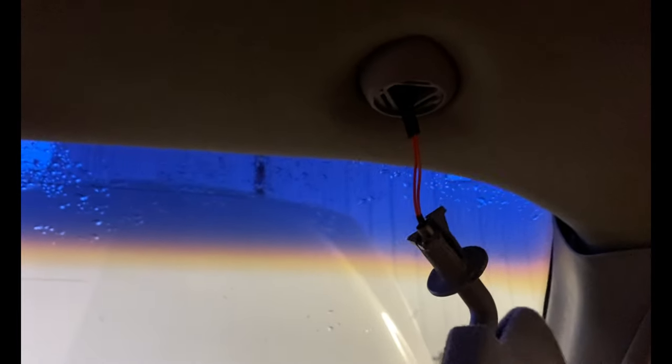You want to make sure your screwdriver is putting tension on both sides of that slot, because these two things are going to turn together — this piece and the piece on the sun visor. You're going to want to pull down until there's a space, then rotate towards the window and they'll fall down. Just make sure your screwdriver has enough tension against the sides.